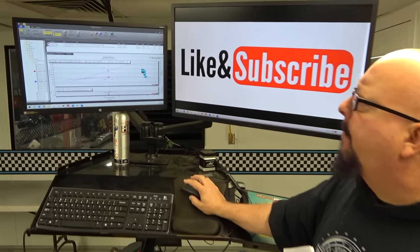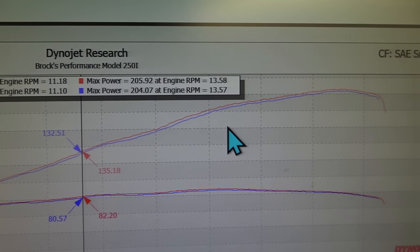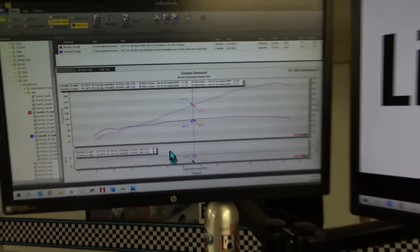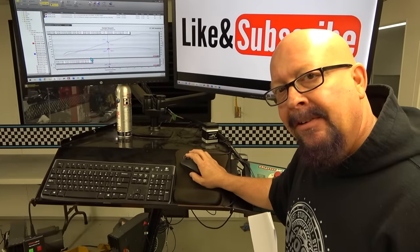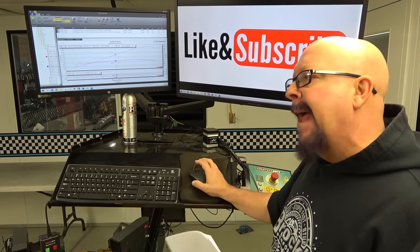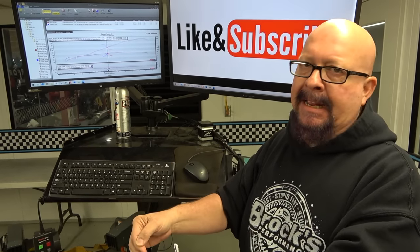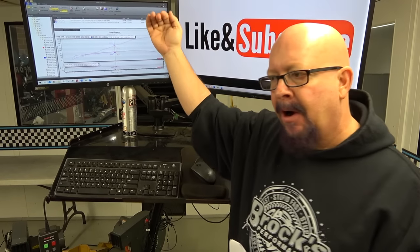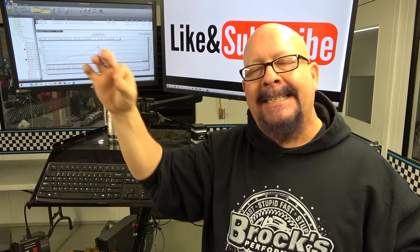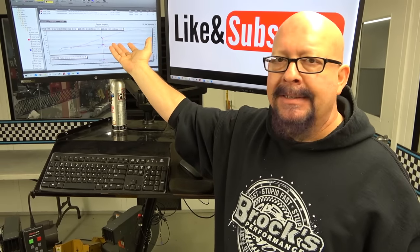All right, all things being equal, absolutely nothing else has changed. You can see we are now the blue line, and we are the happy recipients of less horsepower everywhere, thanks to Mother Nature. Anyway, so what do we do with that? It doesn't matter. Horsepower gains are relative to the day that you're making them. So if we can pick up horsepower on this day, another day we would have picked up the same amount for higher peak numbers. These numbers are lower, it just doesn't make any difference.